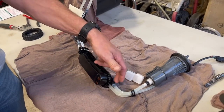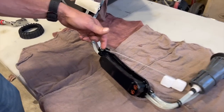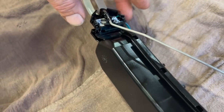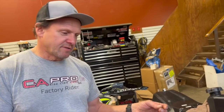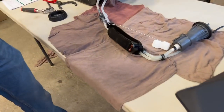The real deal is we're taking off all the metal — there are metal clamps all the way around this. We're taking all those off and replacing them with plastic clamps. Then the fuel level sender card — we're taking that piece off and putting another piece on. There was something with all this metal where they're concerned about an electrostatic charge due to corrosion of a ground, and anything metal in there can make that spark happen.